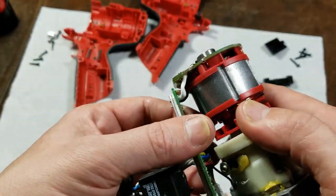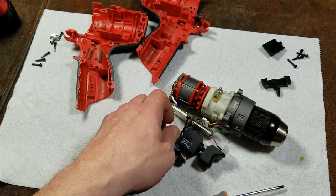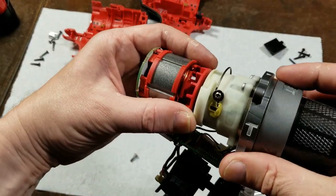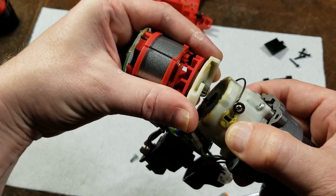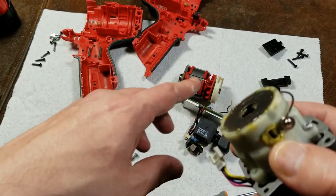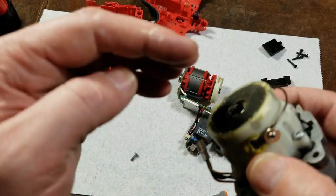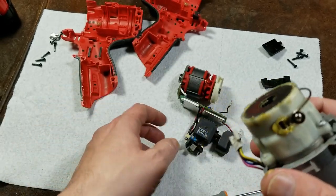When working with this, try not to flex the wiring. The three main power wires and sensor wires are so short that solder has wicked into most of the wire, making them quite stiff. If you bend or force them straight you're going to fatigue them and increase resistance. Now we can hold the fan — this style rotates, which makes it nice and easy. We don't have to yank the motor; the bearing on the front armature just uses a rotating locking collar on this Milwaukee.